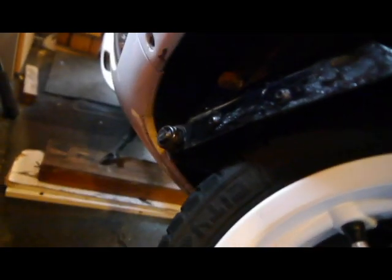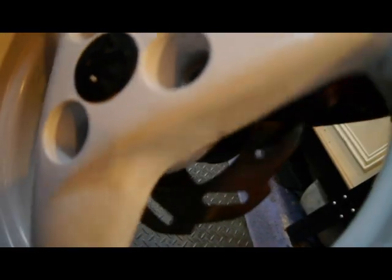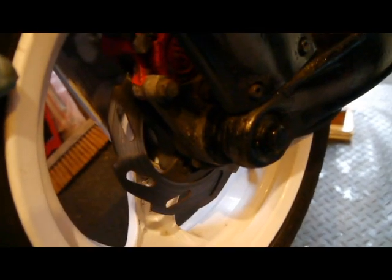Guys, if you're going to be working on the side of the bike, jack the bike up, put blocks underneath it, get the front wheel right off it. This is what was wrong — this bolt here, this mudguard had come out. So I reshaped the washer that sort of goes around it, then took it back off again. Needed a big old bar to get that nut off. The discs — look, they're wavy discs, they look great but you do get this juddering effect. I checked out the brakes — I didn't have brake cleaner, please don't use WD40. I used some carb cleaner, wiped it right off, and that now is a perfect, very nice new front wheel on here. Bloody good wheels to be honest.